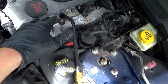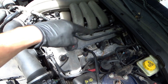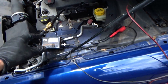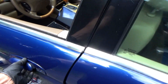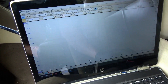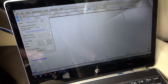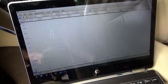That's the first thing I want to check. Just popped out a spark plug, and we'll see on the exhaust stroke on cylinder number four on bank two. If that's elevated we can always compare to bank one. We'll know if there's an exhaust restriction. PHAD pressure transducer, 265 PSI unit. Got our Pico scope rolling — and the seat is always sliding back and forth on its own. Select the custom scales — by the way, this is only for Pico scope 6. Pico scope 7 is not friendly with custom scales, so I recommend you stick with Pico scope 6. We're at zero PSI.